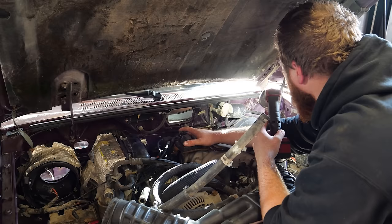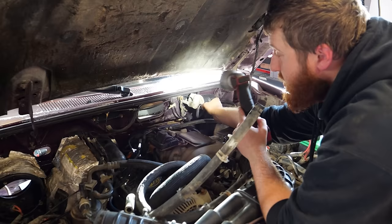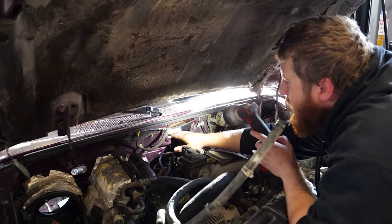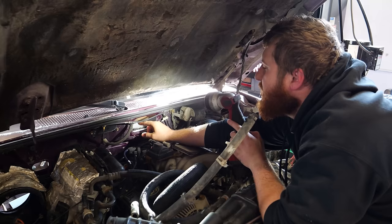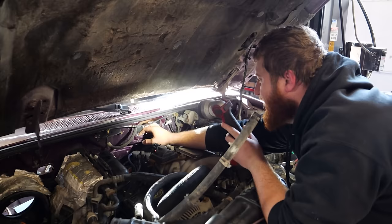There are covers you can remove on the Ford Ranger to wash out the cowl and remove any debris to keep the drains open — sticks, scrubs, stuff like that. This is something you should do on every car, not just a Ranger full of mouse crap. Pop these off — they're on every vehicle. Google where they are on yours, don't email me. Flush out your cowl drains. It helps keep your cowl from rusting out and keeps water from getting under your dash. By the way, if it ever rains and you get water on the floor, your cowl is leaking — it's in here.